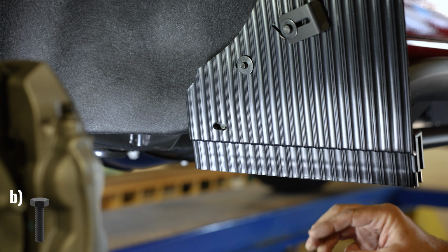With a square or other leveling tool, make sure the mud flap is level. We also recommend you take a step back and visually gauge the mud flap to check that it is aligned correctly. Once your flap is level, secure all fasteners. We suggest you tighten this hardware by hand and be careful not to over tighten any fasteners. Your front mud flaps are now installed. Next, let's move on to the rear of the vehicle.